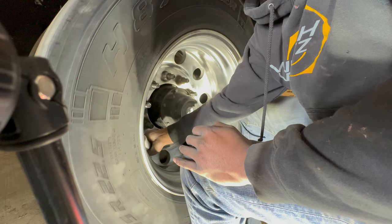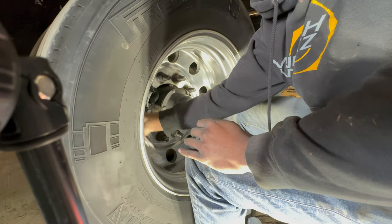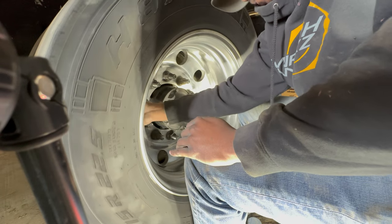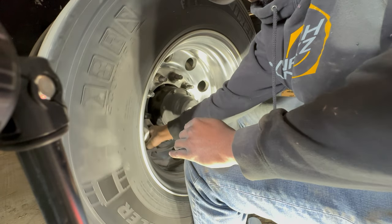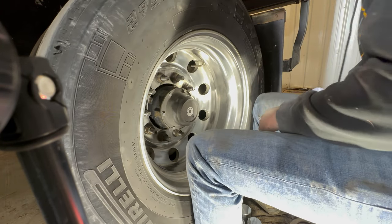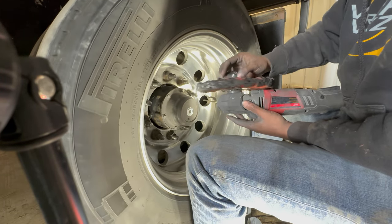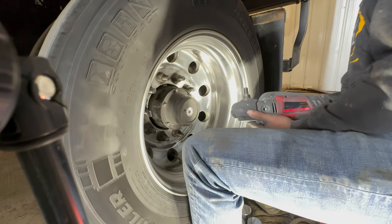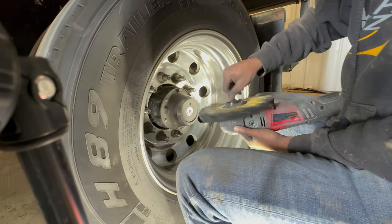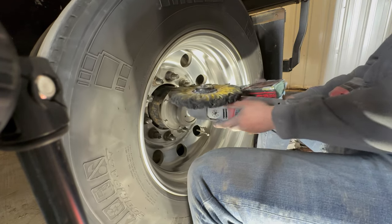And then you'll hit it with your next rouge, and then you'll hand polish the wheel and really get that pop. And then you'll use your three towel method, which I'll go over when I get over that way. So got our residual off, change our wheel out. Over to our yellow. And our green rouge. Same process.